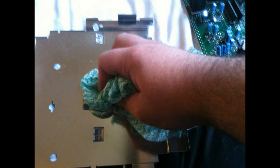And it's the same for the cartridge as well. You just want to get that cotton bud drenched in the alcohol, and just get into the bottom of the connector of your game cartridge and just give it a good clean. Sometimes your cotton bud will come out black, and that's good, I guess, because it means you've cleaned the dirt out of it. So get a good clean. It'll save you blowing in your cartridge every 2 seconds to get it working, and yeah, it is a good way to do it. So lastly, let's have a quick look at this blue LED because it looks pretty cool.